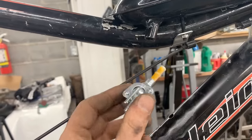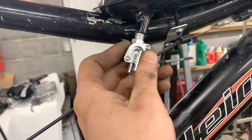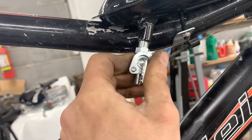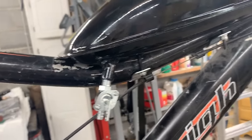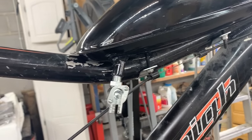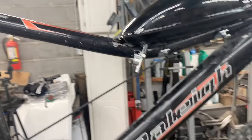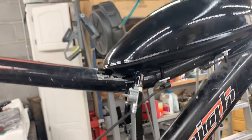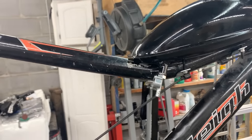We will see. Next, we're gonna put the petcock, but I don't have plumber's tape. So I'm gonna try without. I'm gonna pour some fuel inside and we will see. If it leaks, then I'm gonna have to wait with that part. Well, that went in very easy, so sure, it's not gonna hold without plumber's tape, so that part can wait.